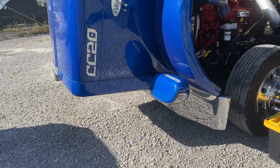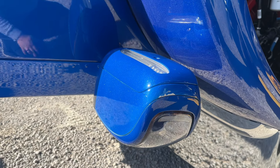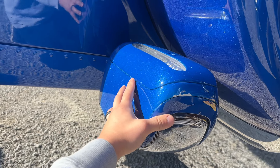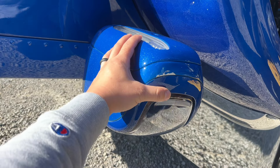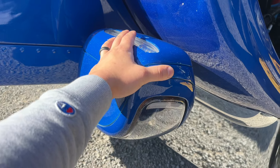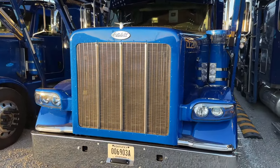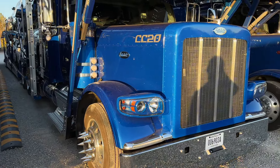So the next step — we have to repaint these headlight housings. They're peeling. Terrible job done in Texas next to Peterbilt, whatever shop did this. So we have to take these off. My boss has extra housings — chrome ones like that. We're going to disassemble it, throw this headlight in another pair of housing, and this housing I'm going to give to a paint guy. He's going to tear off all the paint and repaint it properly with primer. As you can tell here, they did zero primer at all on this headlight. Anyway, we're going to figure out that headlight and the grill issue later. If you guys want a good painted grill and good painted headlights, don't let Peterbilt do it out in Texas — get it done yourself, somebody that you know, a professional in town. They're going to do a lot better job.